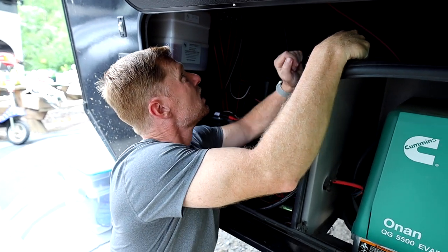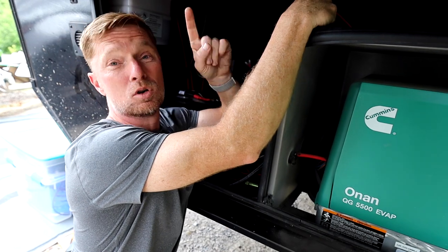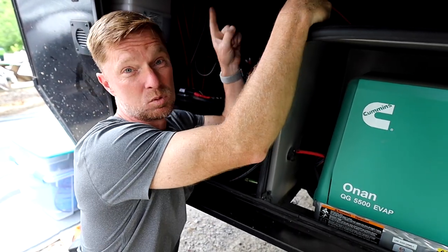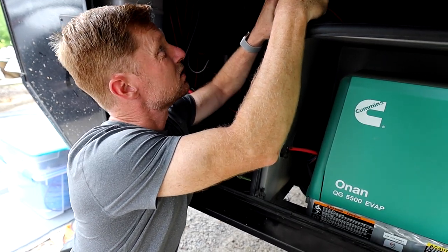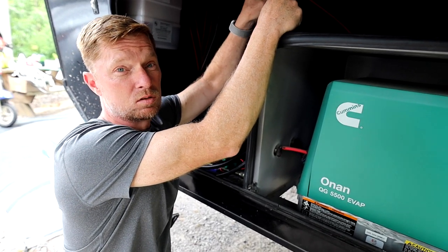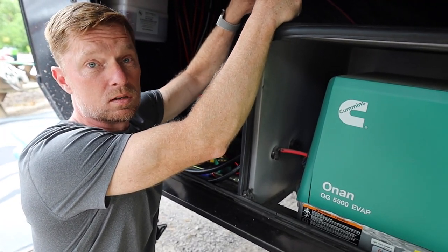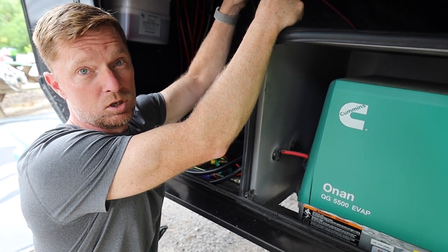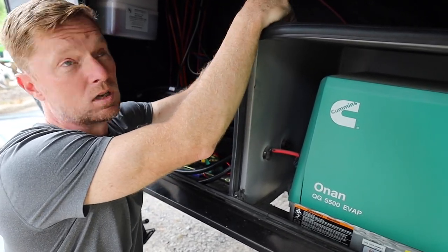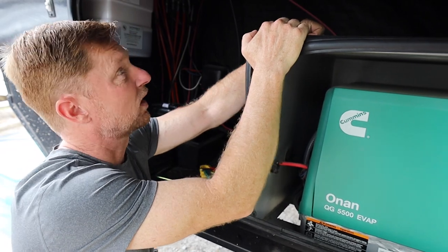As Harold said, there are two switches. There's a flip switch on the back side of the inverter and that's for your pass-through — if you turn that off, you won't get pass-through. When you hook up shore power, it doesn't pass through the electricity. That's really for testing and diagnostics. On the front side of the panel, that's how we actually figured out what was going on, because you're going to read the digital display to see if it has any alerts to tell you where to troubleshoot. We found the power switch on the front — it's right where you would put your stuff if you're storing things in here. So if you have an inverter like this, be mindful of the switches and where you're putting your storage, because you could inadvertently turn things off and not realize it.